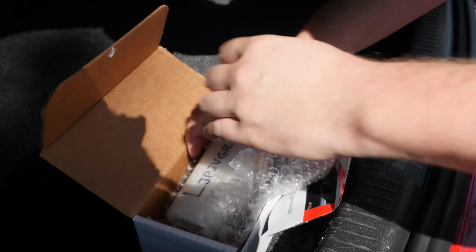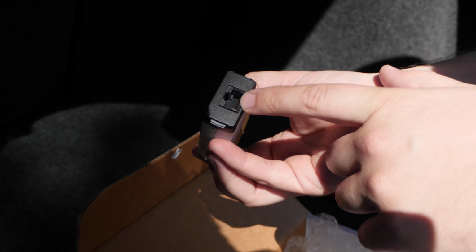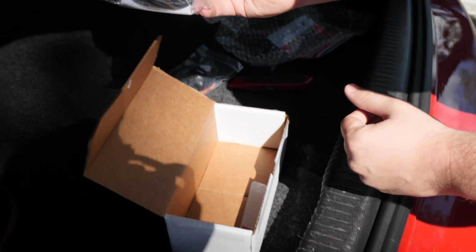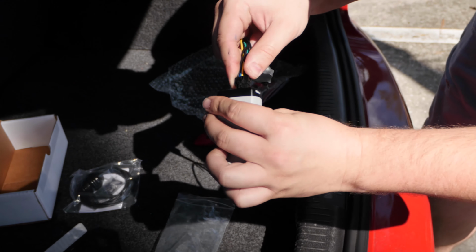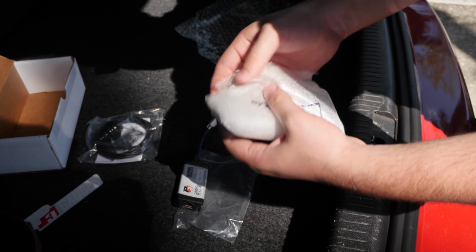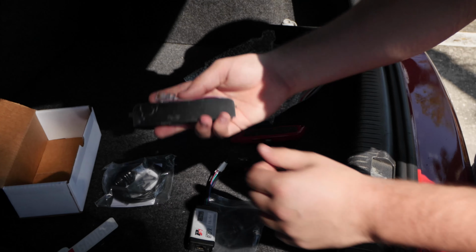So this is our gauge, that's the part number. Here's our control box. The harness goes into here, and then the OBD2 cable feeds into here, I believe. Then we've got our regular harness here. Then this is our boost tap. We won't be hooking this up today. Then your P3, what is this called, Nathan? Sticker. P3 sticker. The OBD2 plug feeds right into this portion of your control box, just like so. Sorry, I had it backwards. And then if we unwrap our gauge here carefully, it'll have the rest of the wiring we need to plug it into the control box.